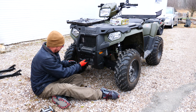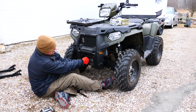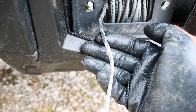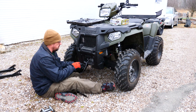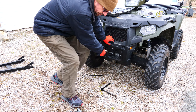It took me a little bit to find the end of the cable here where it's broken, because once it had gotten broken, it just went right back in there. Now comes the fun part — trying to get this thing off because this thing is a pain. The reason why I don't like these winch cables is because of all of these little wire splinters that come out. Even through gloves, I'm just getting poked and prodded like a medical experiment. The only way to get this off is to kind of turn off the gearing, freewheel it so that I can give it a yank. Work smarter, not harder — I got a pair of vice grip pliers here and clamped that on, and hopefully I can pull it right out.